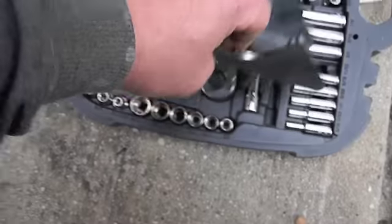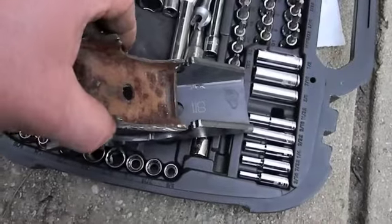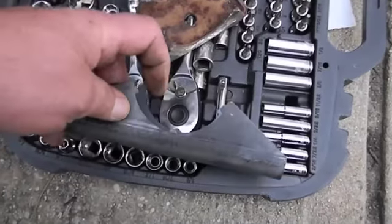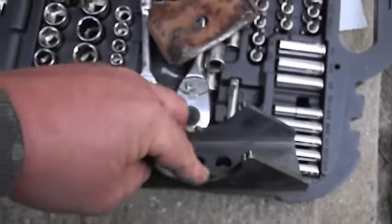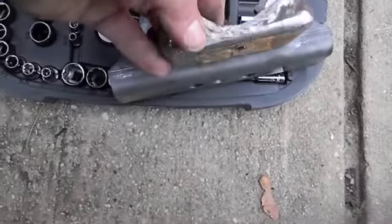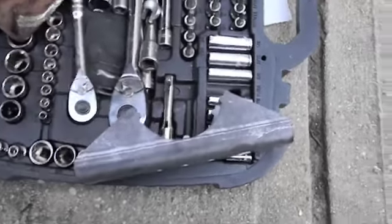Little different. These are for 3¼. They put little nubs for a 3-inch tube. You take the little nubs off and the openings are for 3¼. I gotta shorten them down to the original AMC size. Be about there. I'm going to rest the rear up there first, and then we'll grind these and shorten these. These are nice. We put new bolts in.